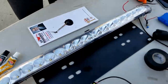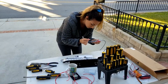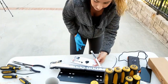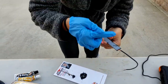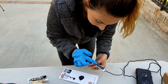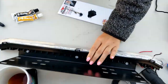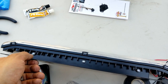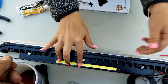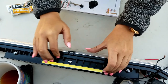The light bar is partially spot, partially flood, so it should give us good visibility while reversing in the evening or just going in the rear direction. Apply the JB Weld with a finger on the flat surface — since the LED strip is super lightweight, we don't need a whole lot, just good decent coverage. Press it into place making sure the wires face the same direction. Push it straight down as centered as possible, and try not to push too hard because you'll break the LED. Before we did this, we wiped down the surface to get rid of any dust. Now we'll tape it into place so we can keep working.